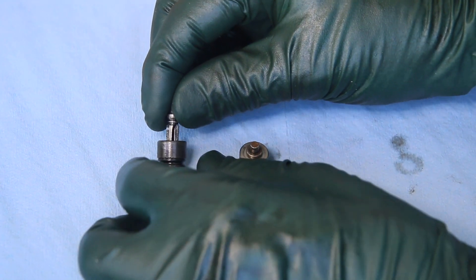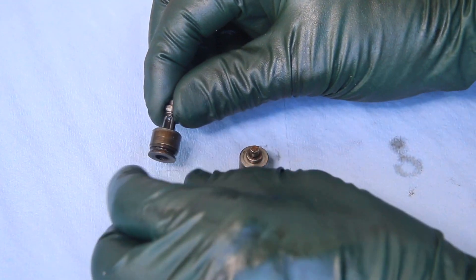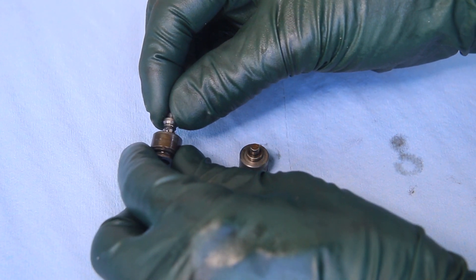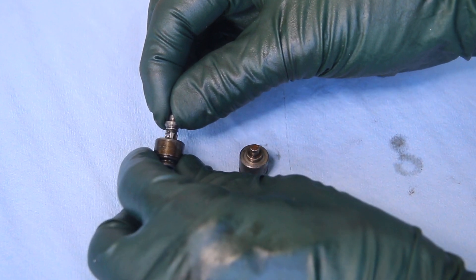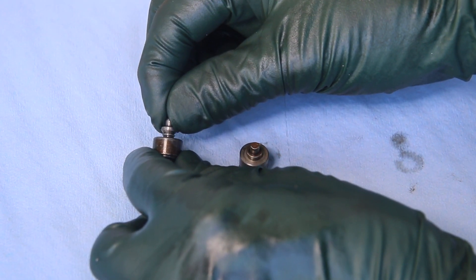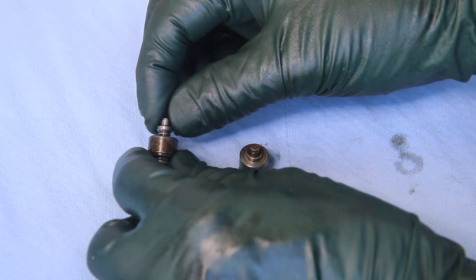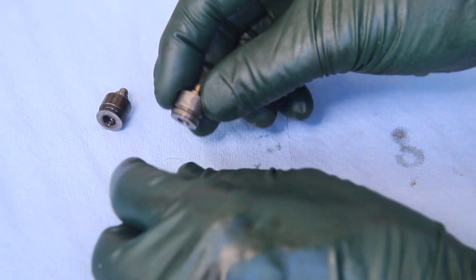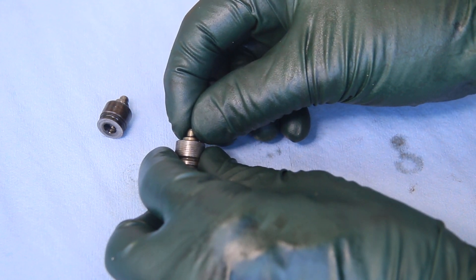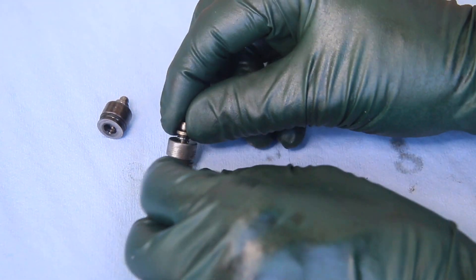This is the one I just pulled out of the engine. You can see a little bit of corrosion — it's not real bad, but I've removed these in the past where they're very rusty. A couple of things you want to check: the sealing surfaces on both sides of the housing should be real smooth, and the valve should have nice smooth movement in and out without a lot of side-to-side play. When I was testing this one, I noticed it hangs up right at one point. If I push hard it'll go down and seat, but that hanging causes concern — I'm not sure whether this delivery valve is good enough to put back. Now, here's a good used one from my stock. Notice less side-to-side play and how smoothly the piston moves in and out right up to the angle seat, seating hard against the housing. So I'm going to install this one.